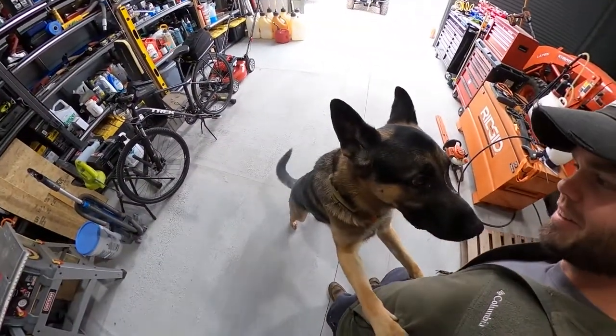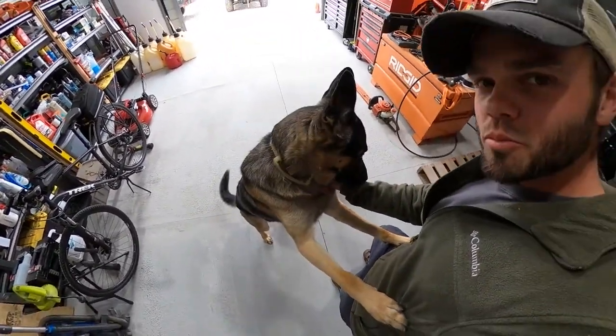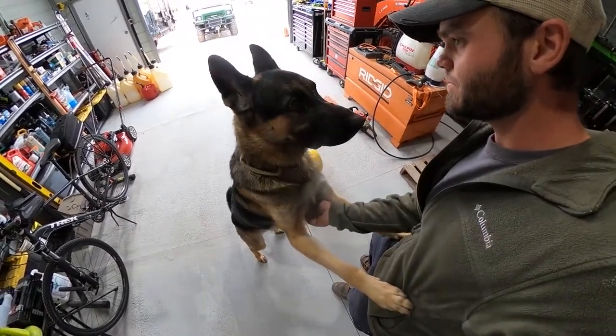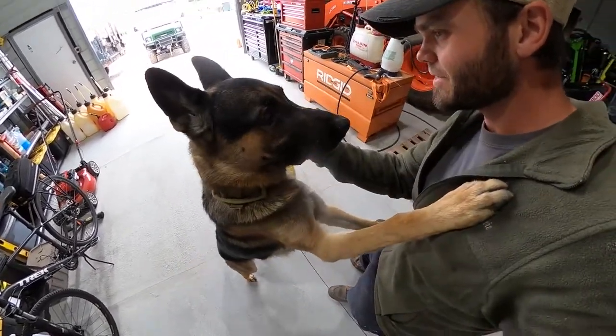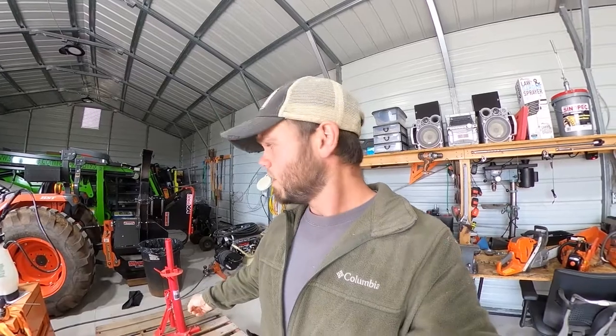First thing — my buddy here came up and gave me a hug. He's got a little scratch on his nose, but he decided to come say hello. Okay, get down buddy, we got to change the tire. So first thing we're going to do is jack the trailer up, take the tire off, get it over here and break the bead. Then we're going to get it up on the changer, take the tire off, put the new tire on, reseat the bead, pump it up, and make sure it holds air. It's that simple.